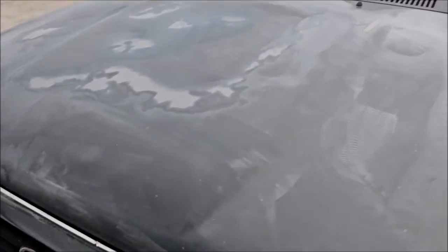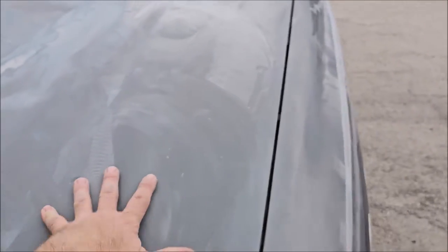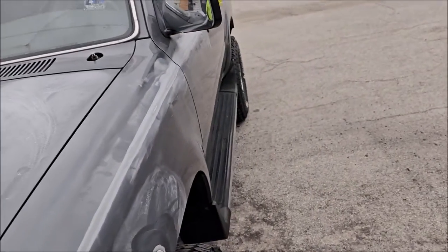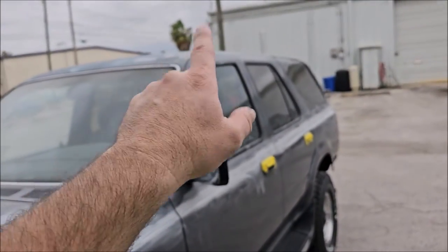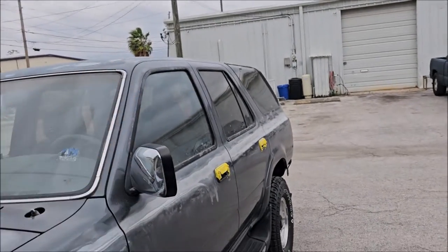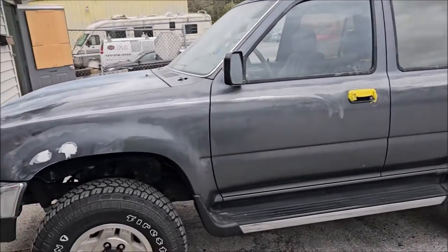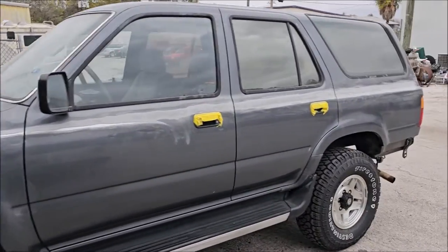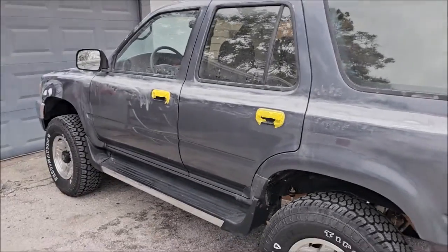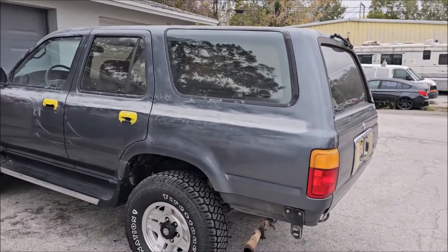I have to sand a little bit more. The hood was 320 grit, which is usually what I start with. The roof required more bite, so I did some 180 sanding. Whenever you're sanding, you always want to back it up before you spray — you don't want those sanding marks in your paint job. A lot of people say 600; I like to go up to 800 before I spray.